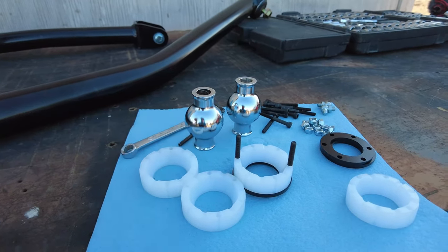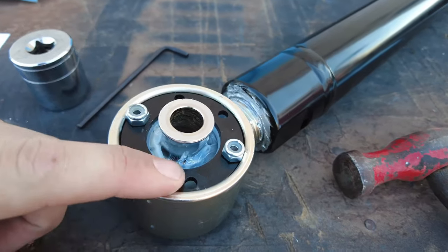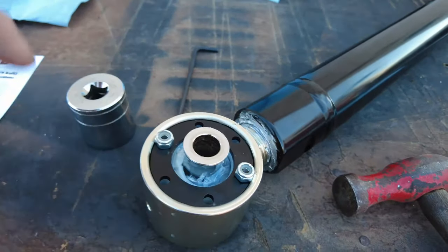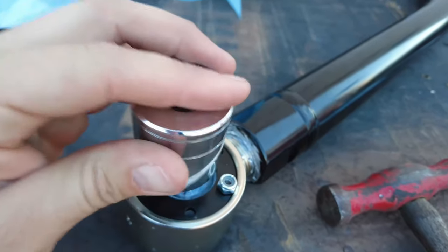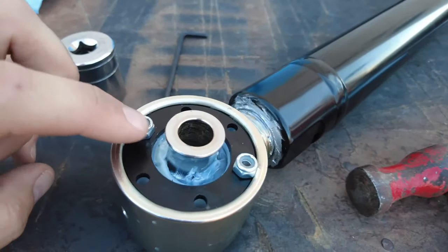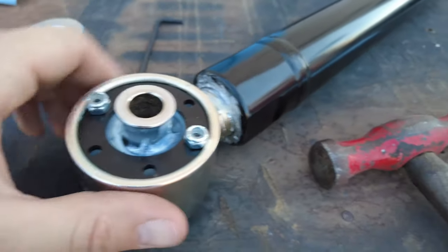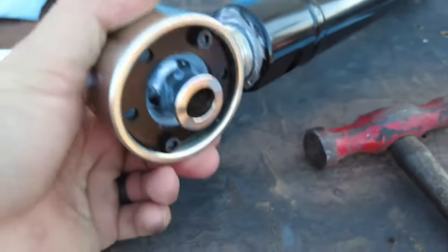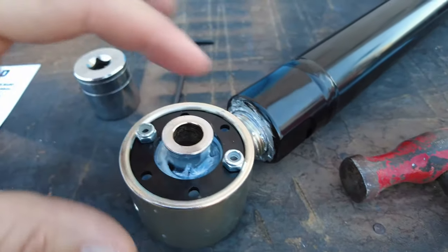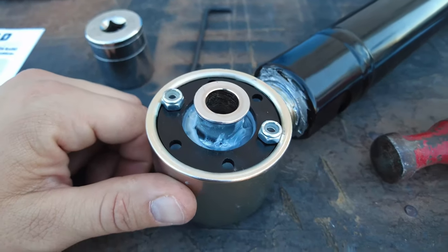Since the tolerances of the race are so tight to the joint end, I put the washer on top after starting two nuts through the bottom, then placed the largest socket I had on there and lightly tapped it with a hammer to slowly press it down until I could get thread through the bolts. The tolerances are so tight that the nuts hold themselves in place while you tighten. Once you get two bolts and nuts started, insert the other four and get a couple of turns, then torque everything down.